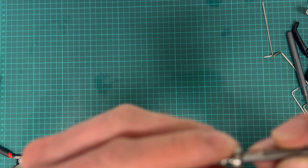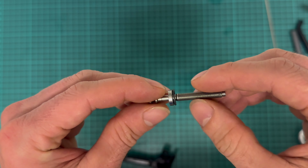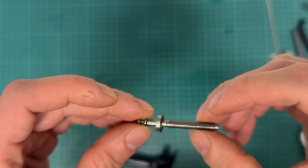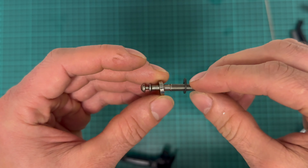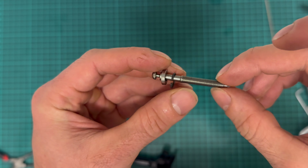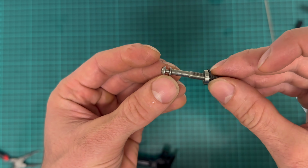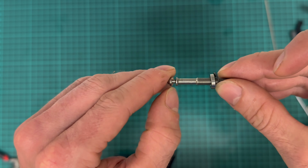So this is the main pusher rod. And this screw is the adjustment of the reach. This moves on the lever blade. We have some kind of washer, a really thick washer here, and a snap ring. And inside this pusher rod, there's another rod which is adjustable by this screw. And this is the free stroke adjuster, or the contact point adjuster. So this length.